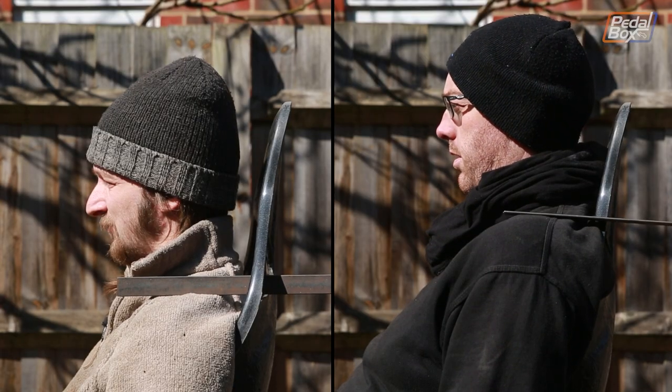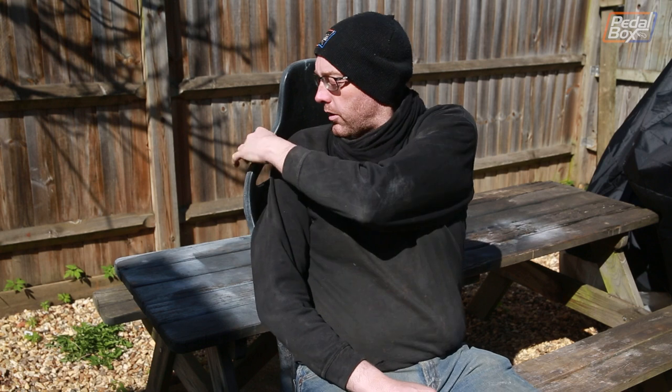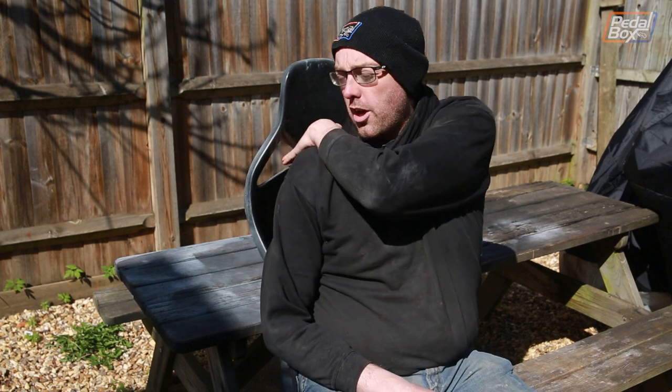You can see the problem: where Chris's shoulder managed to line up with the hole in the back of the chair, mine definitely don't. If we did have a harness bar at a regular point around here, my harness would go down underneath, around, and have a bend in it — so it wouldn't tighten properly and would inevitably end up snapping in any kind of impact. So we need to get some bar that will suit my shoulders above the seat and Chris's shoulders through the holes of the seat, and hopefully we can reconcile both of those things in one.